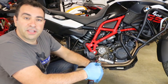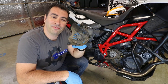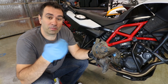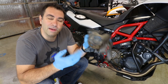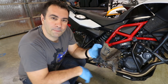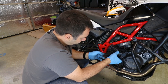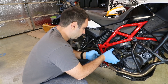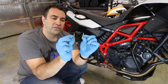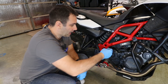There we go — 50 newton-meters. Next step is to put the cover back on. I just scrape it up roughly since more dirt and grease will get in there anyway, so making it shiny won't last — a quick scrub and it goes back on the bike. Two of the three bolts are identical so it doesn't matter which you put where; the only thing that counts is that you put the short one up top.